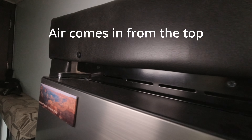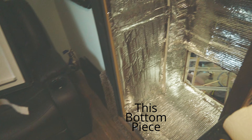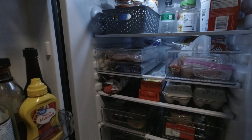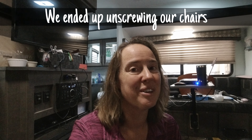When we were installing it, we cut off some of the fan circulation at the very bottom. There are fans underneath the refrigerator that blow air from the compressor into your cabin, and if you have something blocking them, that reduces the efficiency greatly. A piece of Reflectix got tangled when we were pushing the refrigerator back into the compartment. Another problem is getting a shelf out with the door — in our rig, with chairs right there, there's literally no way to get these shelves out unless we unscrew our chairs. So when you install this thing, make sure your shelves are in the right place.